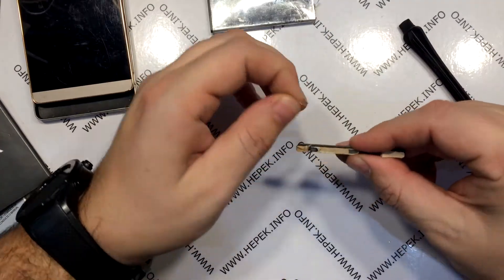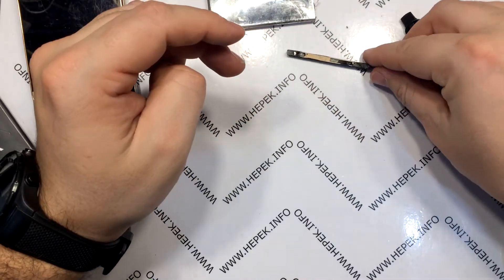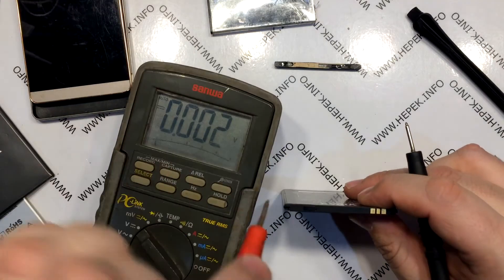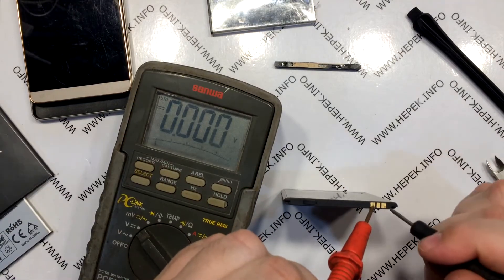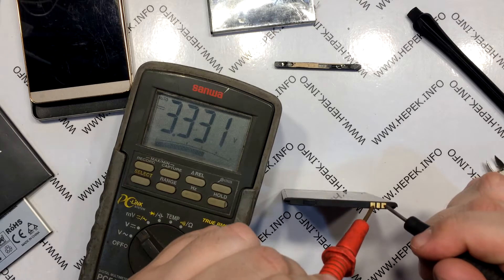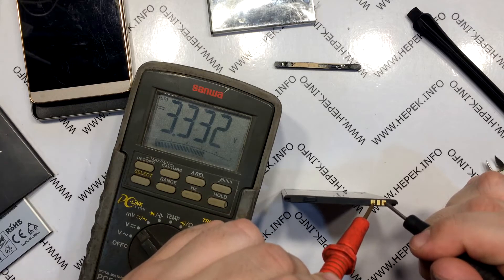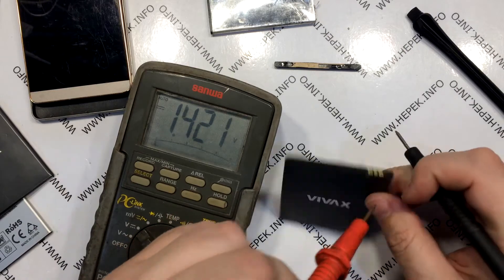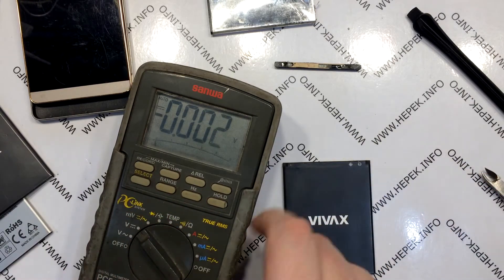Let's check if our new battery has charged a little bit. When we position the battery so that the contacts are on the right, the left battery contact is positive — it could be said to be quite the opposite from the original battery. But that will not be a problem for us. Let's peel the new battery now. I check the polarity again, and on the new battery I remove the plastic from the cell — here even more carefully, because this battery is working.